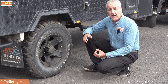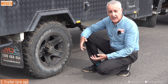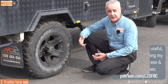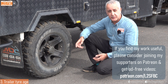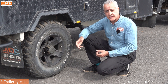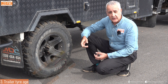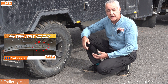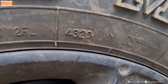Still on tires, the next point is tire age. Tires will actually age out, and there's debate about when a tire is too old — five years, eight years — but the reality is there's no fixed time. It depends on how the tire has been stored and used. With caravans, because they don't do a lot of kilometers per year, the tires can end up being very old and unable to grip the road or flex properly, yet still have plenty of tread depth. I've got another video explaining how to check tire age, which is especially important when purchasing a caravan.